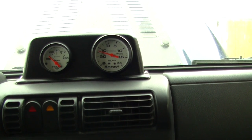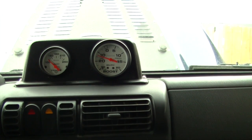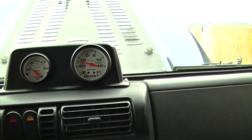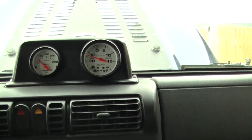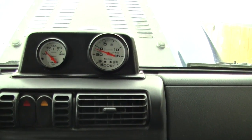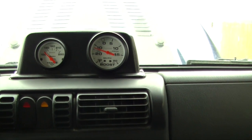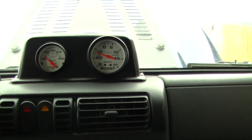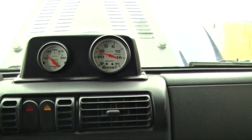There's a test you can do — hit the throttle and watch it drop and settle back down. I went to zero and then down to 20 and back. So I'm gonna get a cylinder leak-down tester because I believe my rings, even though compression is good, may be leaking past the rings — the rings are worn out in the engine. That's my guess, but we have to troubleshoot more to find out.